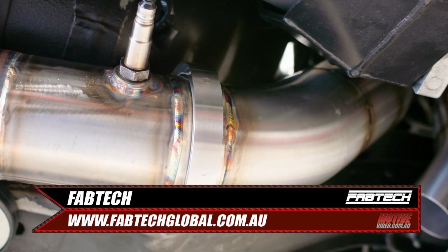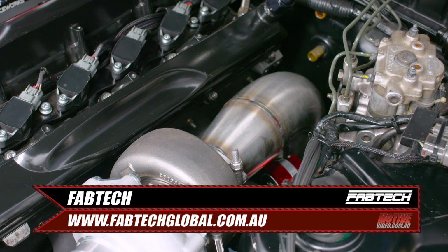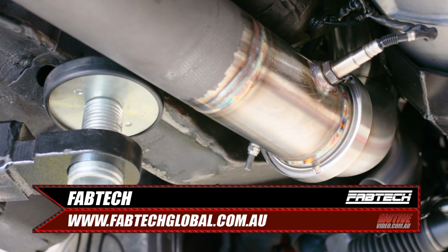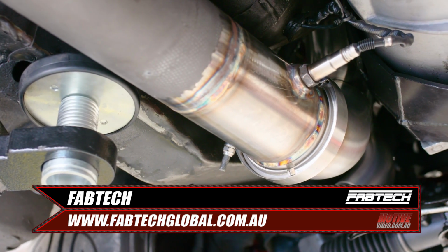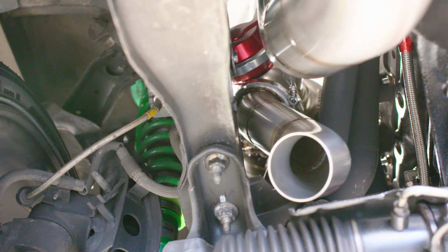A new dump pipe was necessary as the G35 is a different size to our previous GTW. It's made from stainless steel and expands out to 4-inch to match our custom exhaust system. Dion also fabricated a new screamer pipe that is 2.5 inches.